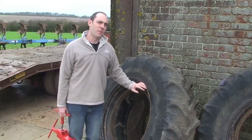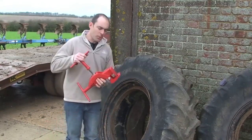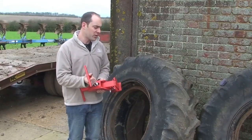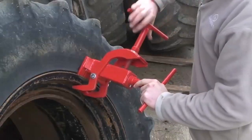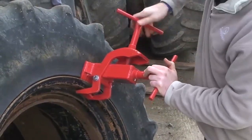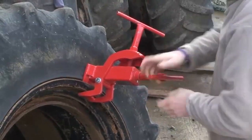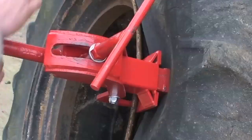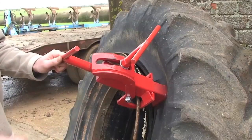Currently this will give protection down to about minus 15. Busting the bead off tyres can be a really tricky task — it usually involves several hours of misery and skinned knuckles. This is Spalding's bead breaker. It's a couple of hundred quid, but I think it's money well spent because it makes the job a whole lot easier. It's just a case of screwing the blade down behind the rim, and then once that's in position, winding it out until the bead pops off. Then it's just a case of kicking the rest of the tyre off the rim.